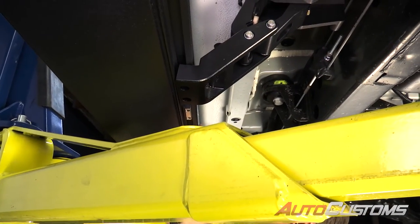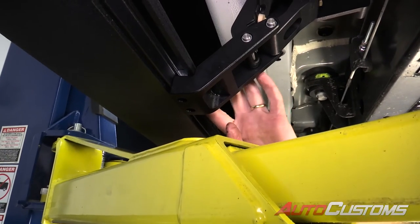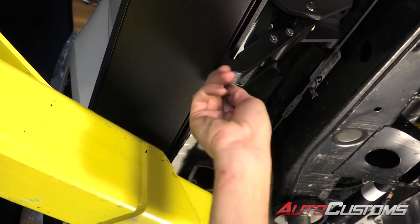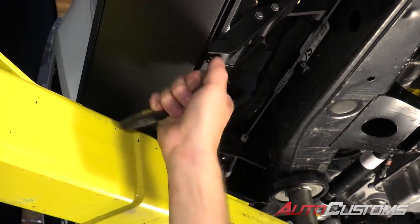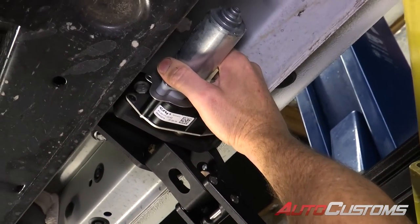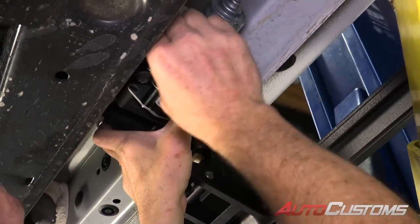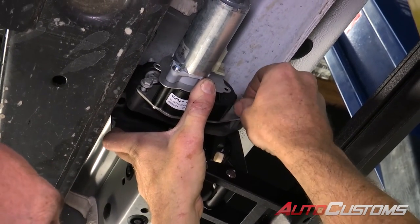Now we're going to go ahead and set the boards in place on top of the brackets. We're going to slide the clamp block where it can drop down into the board. We're going to line up one of the bolts and just get it loosely threaded into the clamp block. Once we have the board centered on the cab, we're going to put all the rest of the bolts in, tighten them down, and then move on to the motor. We're going to tighten down the board to the brackets with a 3/16 Allen wrench. Now the motor gear is going to go into the housing, and these holes are going to line up with the pegs on the bracket. We may need to move the board up a little bit to where the motor lines up. Now we can use the provided hardware — thread those in and then tighten them down with a 10 millimeter. We're going to do the exact same steps on the passenger side.